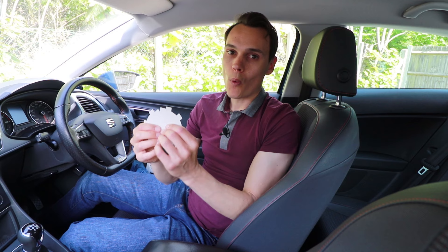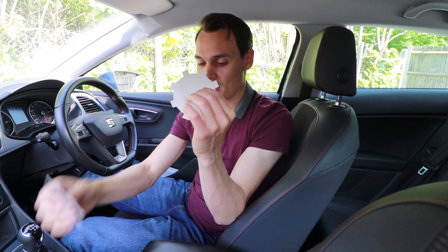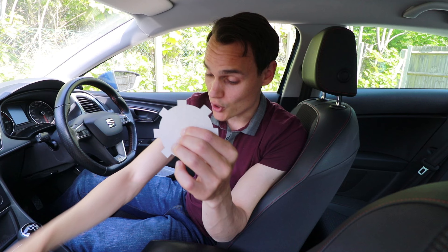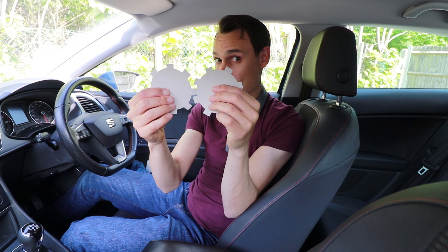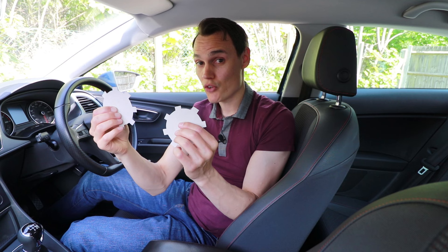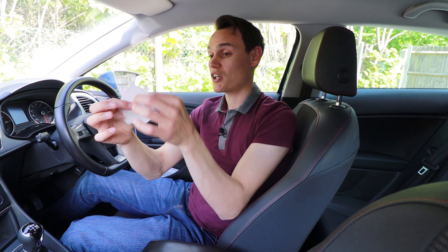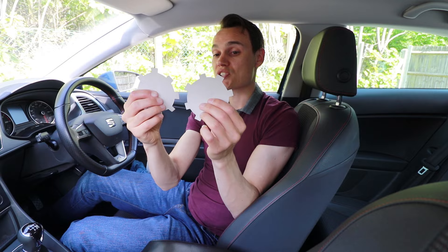How to stop it: when you press the clutch down, don't select reverse immediately. When you press the clutch down, the gear on the input shaft of the gearbox doesn't stop instantly — there is inertia and it is still spinning, and it stops slowly. Give it a couple of seconds and it will stop; then you can engage reverse without them spinning and no harm is done. Also, don't be moving when you select reverse, because if you're moving, the gear on the output shaft is doing whatever the wheels of the car are doing. So make sure you come to a full stop, clutch down, wait a couple of seconds — then your gears shouldn't be spinning.